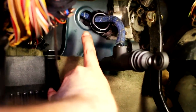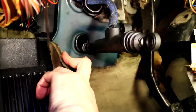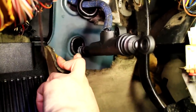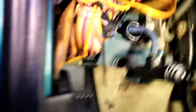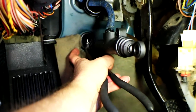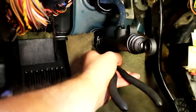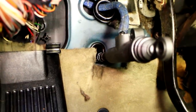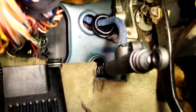We're working to get the blue line fed back through the grommet in the firewall. I went ahead and reconnected the clip that clips this onto the hard line for the pressure side — that metal clip just sort of snaps over the whole thing when you're pushing it together. I used my hooked pliers to hold the line from being pushed back through the firewall, then pushed the master cylinder onto there and clipped the clip down to lock it in place. There was an o-ring in there that I replaced as well. So I'm working on feeding the line back through the firewall, gonna get that hooked back up to the master cylinder, and then we can start bolting things back together.